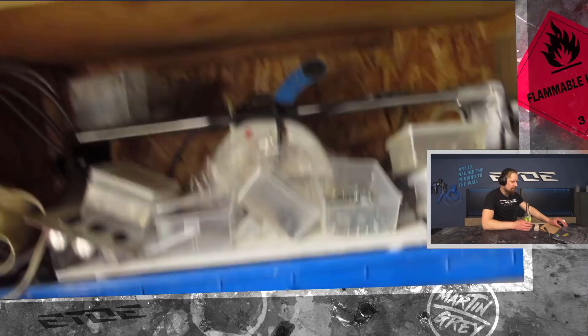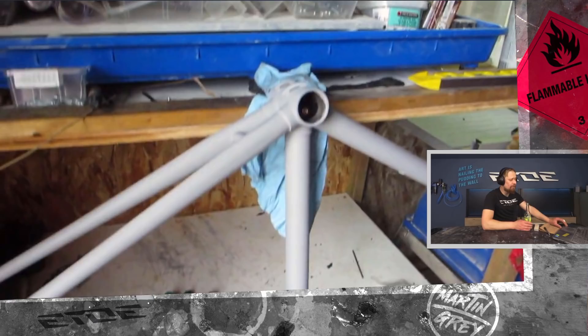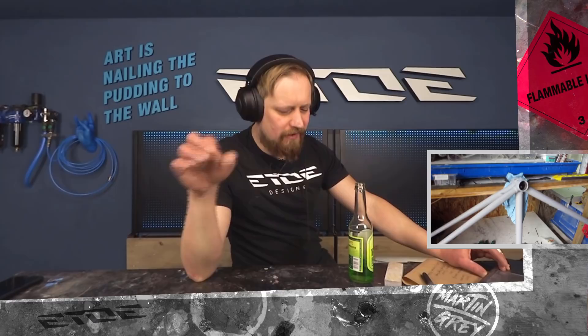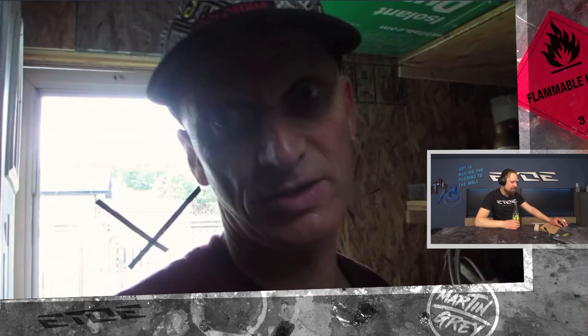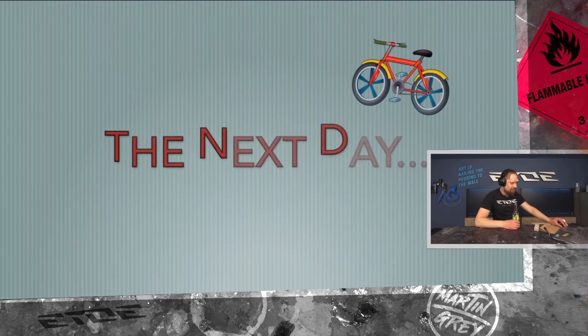With this being Edmonton, just as I got this primer on, it started raining, so I had to act fast. If you paint outside, make sure there's nice weather. If it starts to rain, you will ruin the paint job — you get drips in the color. So maybe have a spot in your garage to paint — that's much better. If you paint outside, all the flies like color; he will paint on a yellow color and flies like yellow and red, so you will have hundreds of flies in the wet paint. The primer is good to touch and it looks very smooth. Tomorrow I'm going to touch up the primer where it needs it and if the weather is good, I'll apply the finishing coat.